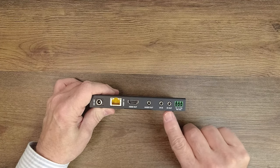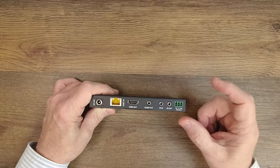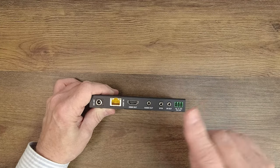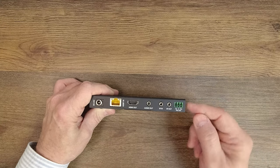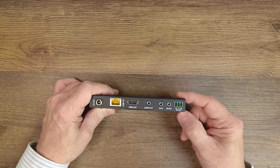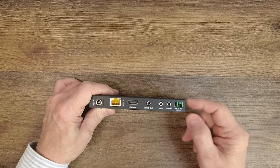To the right of that are the two infrared blaster ports — infrared in and infrared out. In the case of the receiver, you're going to plug the larger module into the infrared in port and that's going to collect all the remote control signals from this location and send those back to the primary location over that same LAN connection. And finally there's an RS-232 connection on the end used for sending RS-232 control signals across that same LAN connection — if you need to use that, there's a block included that makes connecting to it very easy.